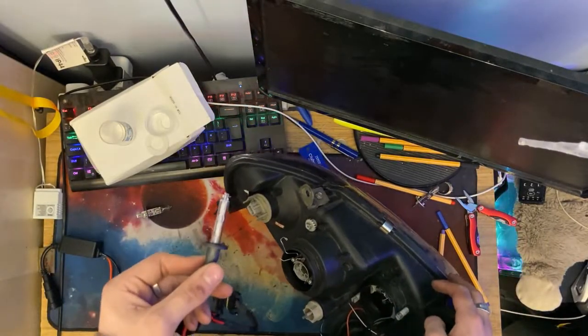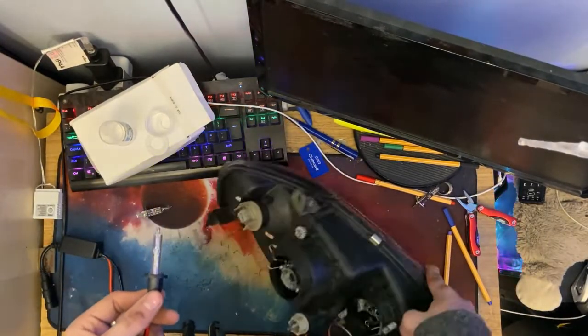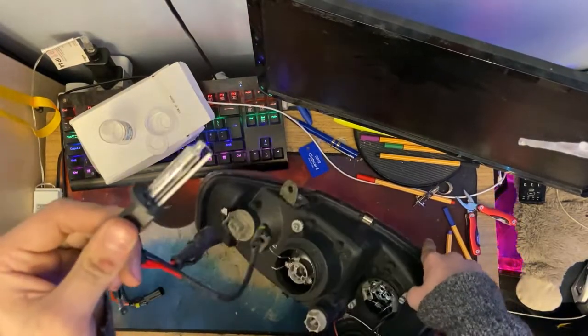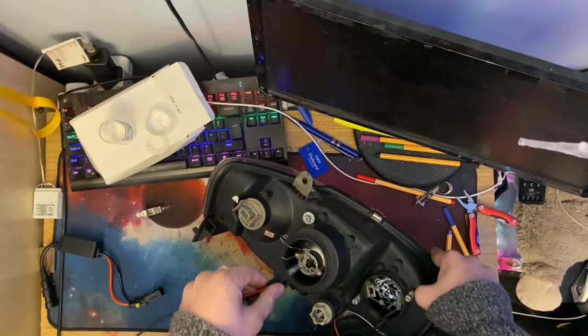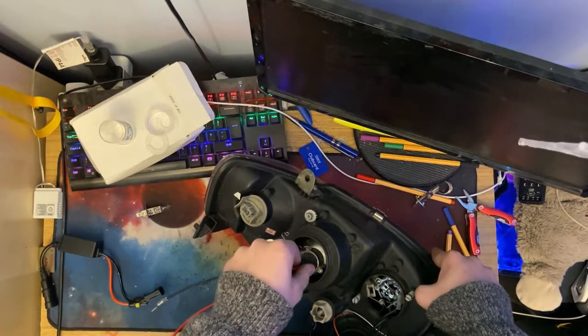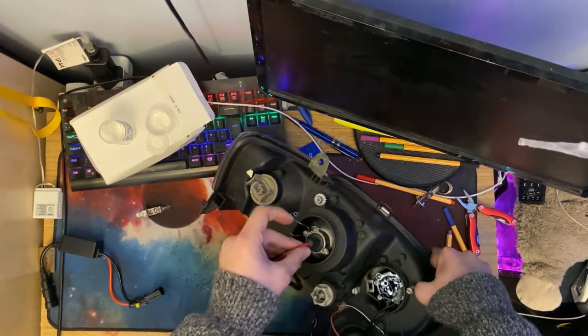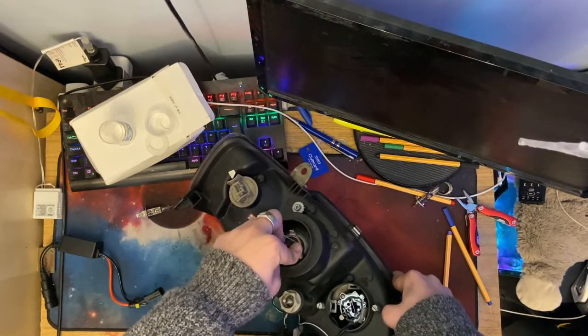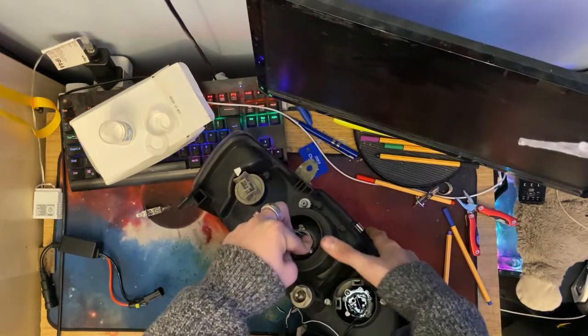It's not 100% easy to get it that way. It might not necessarily sit in that way. In my case, I can already tell you it will. But ideally, you need it so this strand of wire points down. So, insert the bulb. Make sure that's sat in nicely. Bring the metal tab back over. And just the same as fitting any other bulb, that's that fitted.